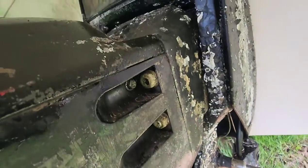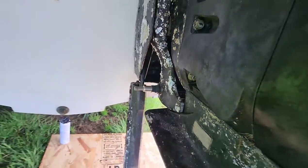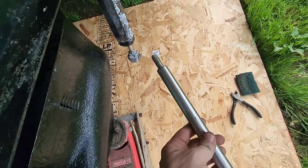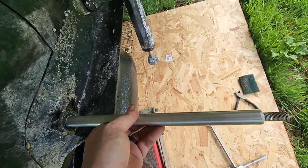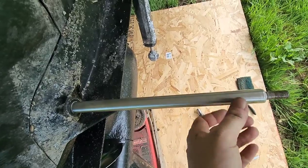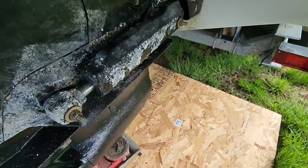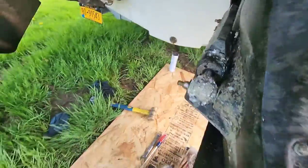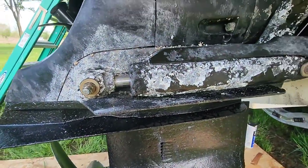With the six bolts, or nuts, tightened up, it's time to put the trim cylinders on. I took the time to clean up my shaft on my outdrive because it was in rough shape, real oxidized. You don't have to, but it makes putting things together a little easier. Once both your trim tabs are back on, both sides, and you may have to use your floor jack to jack your outdrive up or down slightly.